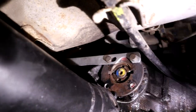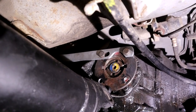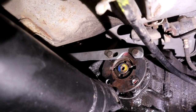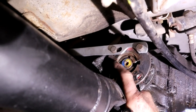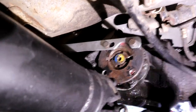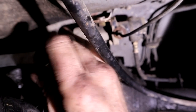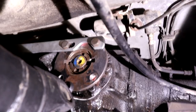That bar I've attached is a stopper bar to stop the flange rotating. It's a fan removal bar I've just bolted to the flange. Hopefully I can get enough torque to undo this nut. Unfortunately, someone has peened it inwards instead of outwards — you don't need to do that, you just need to peen it outwards because that sleeve is captured on that nut anyway. So I'm trying to get it out of one of the grooves to get my special castle socket on the end.